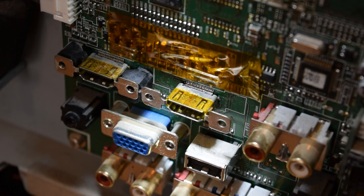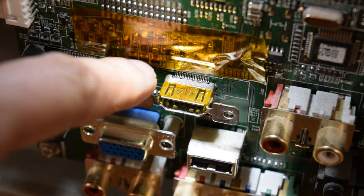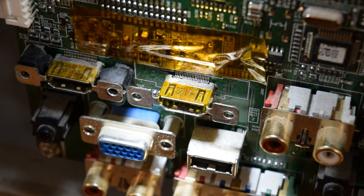Because of the way I'm set up here, I don't have enough room to get in here and work with the hot air gun and have the camera on the connector while I do the solder. You may be able to see here that the signal pins are all now re-flowed. I've looked at this with my loupe and I don't see any shorts — everything looks like it's connected properly. The solder fillets may not meet IPC standards, but they should be good enough to make this port work again. So now I've got the soldering iron heating up to solder the two ground connections on either side of the connector body.